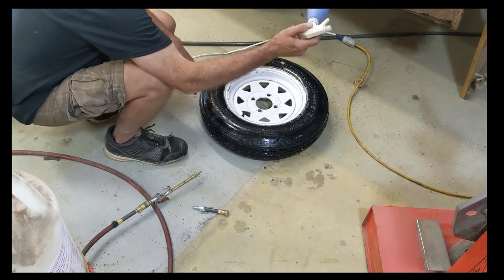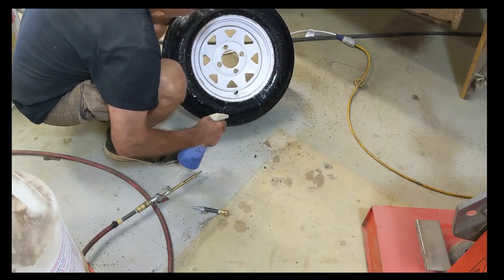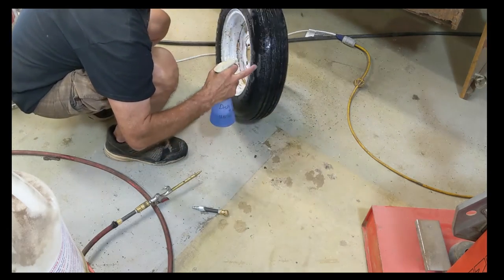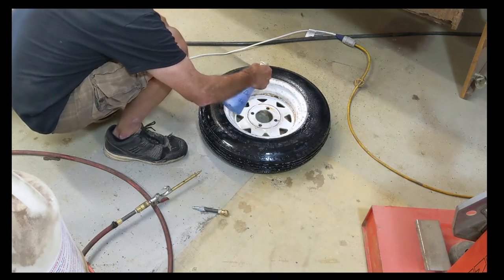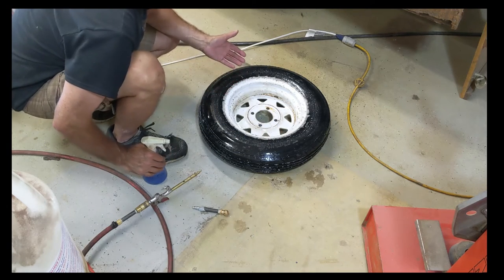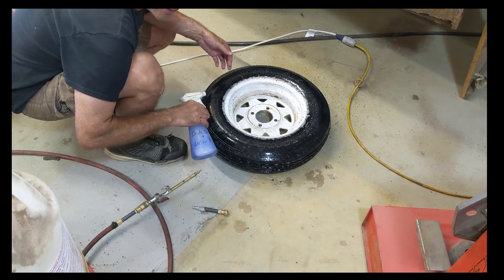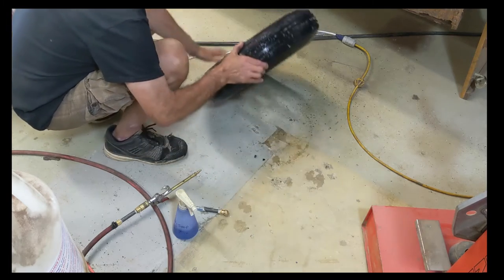Again, using the personal hygiene fluid here — and I was worried about that valve stem. All you're doing is spraying it on areas that could be a potential leak. There are only three: the valve stem, and each side of the bead — unless the tire has been damaged. This is a brand new tire, so I'm pretty confident, but if you're using a used tire you might want to go over the whole surface and look for fine leaks. What you're looking for: if the tire is leaking around the bead, you'll start to see bubbles — like blowing bubbles. Actually, if you're on the side of the road and camping, you can test it with that bubble fluid for kids' bubblers — works just as well. It looks good on that side.